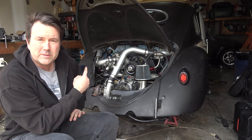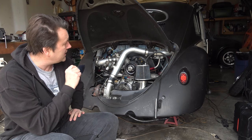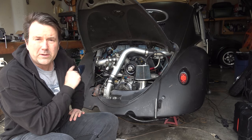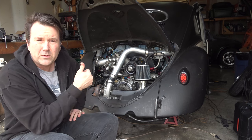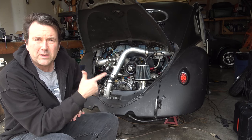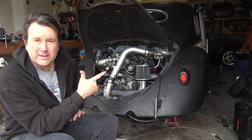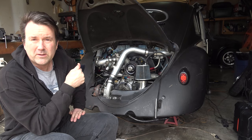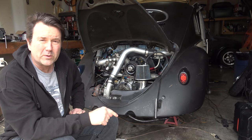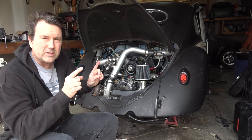I still got the spark plugs out of the engine, so once I get a good level of oil in here, we'll start rolling it over and try to get some oil pressure. Once we get the oil pressure, we'll try to see if we can get fuel pressure without any leaks, and then we'll put the plugs back in and see if it ignites and comes back to life. I'm kind of excited to see what color this oil is, so let's get busy.